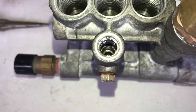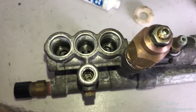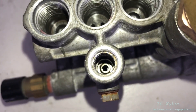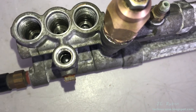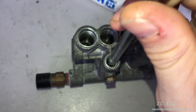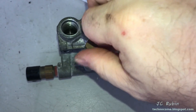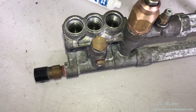Next is going to be this check valve right here — drop the spring right down, make sure it's seated nicely, get a pair of pliers to make sure it's standing straight up. We can see the spring is perfectly seated all the way down. Then I'll drop the bearing, which I've already polished, and that just falls right down there perfectly. I'll just test it — I shouldn't expect it to bind. Everything is just absolutely fine. Put some 327 on this nut that I've already cleaned up and I'm just going to close this up now, by hand, and tighten it.